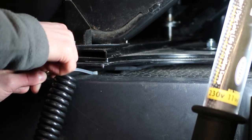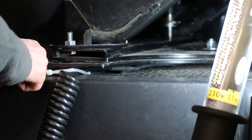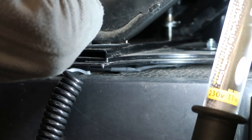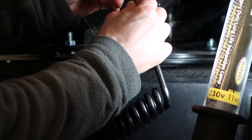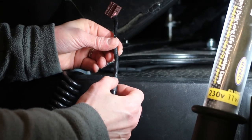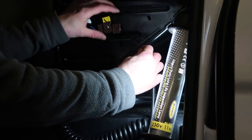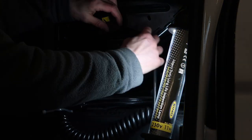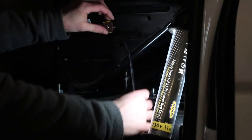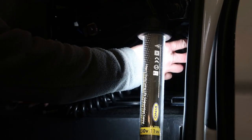Seat the connector all the way in there and then tighten it up. The solder joint inside here is very stiff so it needs to be supported — if it bends around there it could fatigue and crack the copper on either side of the solder joint. So when this end of the cable goes into the connector at the seat, I need to make sure this joint is well supported. I'm going to cable-tie it to the frame of the seat in two places.